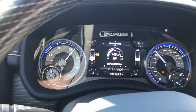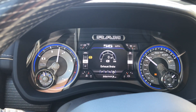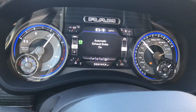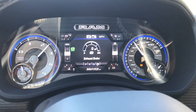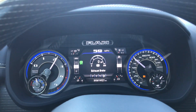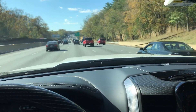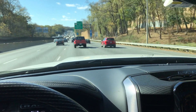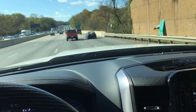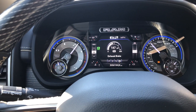So as you can see, that's full diesel exhaust brake — when you take your foot off the gas it kicks in. Now switching to the auto setting, you can see it shows 'auto exhaust brake on.' With my foot off the gas it does nothing yet, but when I get to a spot where I can tap the brakes I'll show you what it looks like. Whenever you have traffic and a car cuts over without signaling — this is when you'd want full diesel exhaust brake. Right now I'm still in automatic. I'll tap the brake just slightly — as you saw, it comes on pretty abruptly.